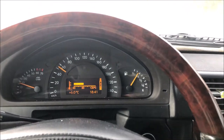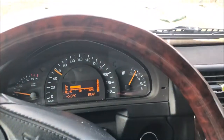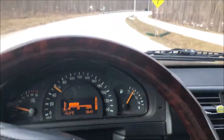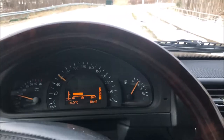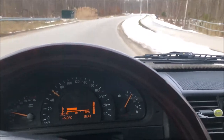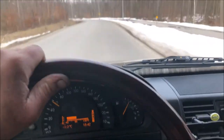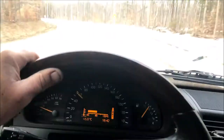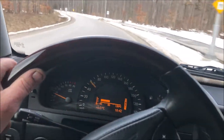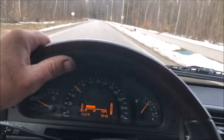I've driven about 15 miles probably, about 20 kilometers. So I should be able to, if I hammer it and then let go. I wanted to get most of that seafoam out first, because it could have been lingering in the intake manifold. I didn't want to be giving it high throttle if there was seafoam sitting in there and have it suck into the engine all at once.